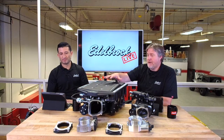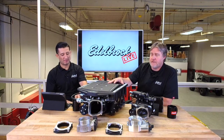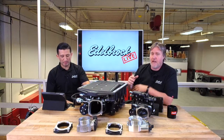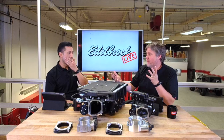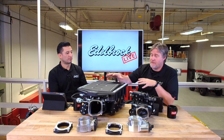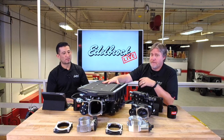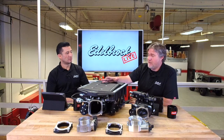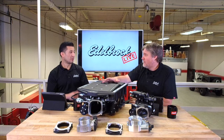What's exciting about this is our original kit used the stock 80 millimeter throttle body. This new inlet has been redesigned so it allows you to use an adapter for a bigger throttle body. We've got some guys in the field that have already installed this and they're making really good power. The base stage one kit, you're making well over 600 horsepower at the wheel.